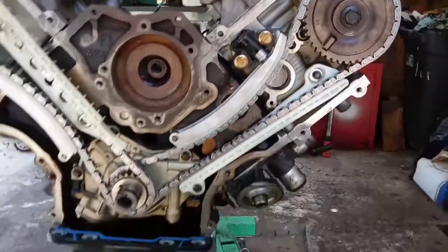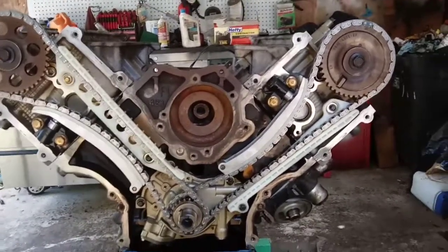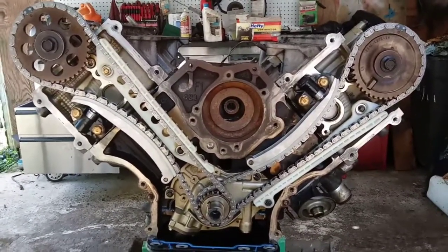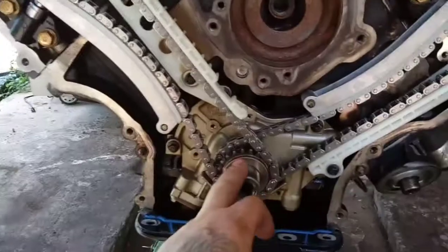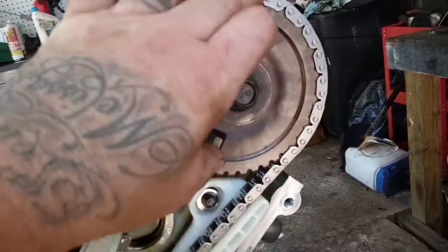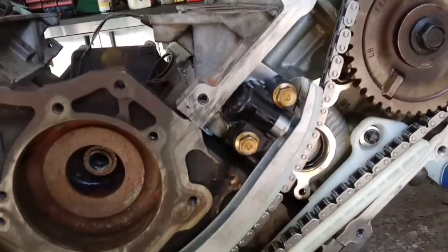One of the key things about this engine — I know I've got a 5.4 3-valve video where I talk about how a lot of people say it's an interference motor, but in fact it's not. Well, this 4.6 2-valve IS an interference motor. So whenever you get your cam on, or you're putting your head on, you need to make sure that with your heads off, you line this keyway up with this groove. Then get a round-and-about mark on your cam gears, so that when you set this head, you're not torquing the head down with a valve hitting the piston.